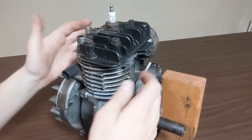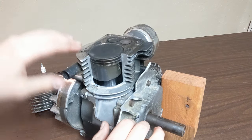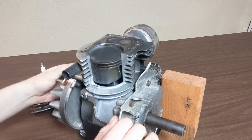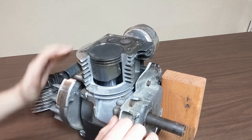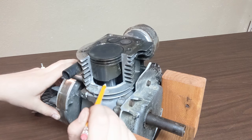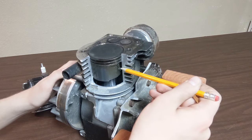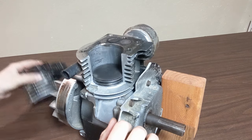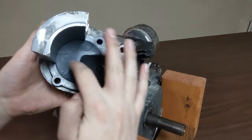Now we're looking at the front side of the engine where we have the outside of the cylinder, the head, and the spark plug. Inside we have the piston and the rest of the cylinder on the inside. This is where the piston lives and slides back and forth in the cylinder a few thousand times every minute when the engine is running. There we have the two valves which open and close at their respective times. On the piston and connecting rod you can see a slight portion of the connecting rod in the middle, and here we have the wrist pin which allows the piston to have the wrist action it needs as it's moving up and down. Here we have the head with a gap for the intake gases to come into the cylinder and a gap for the exhaust gases to exit the cylinder.